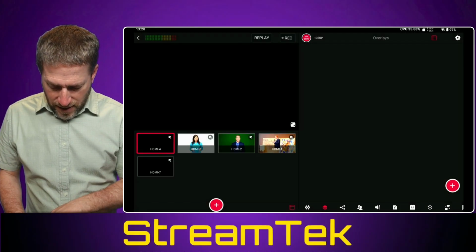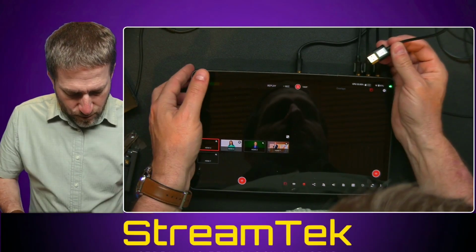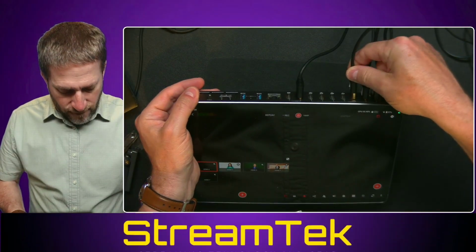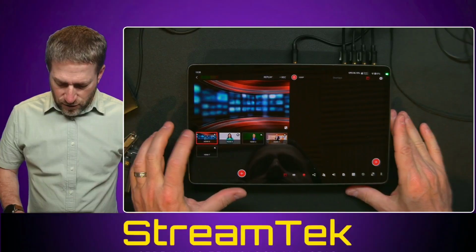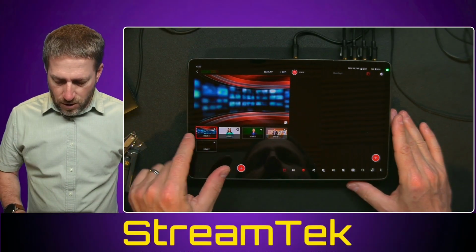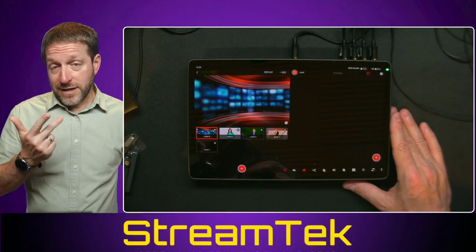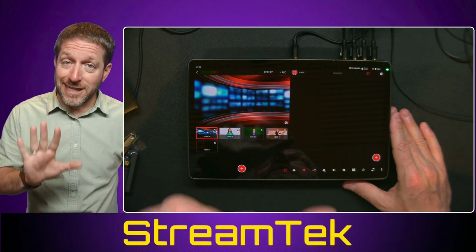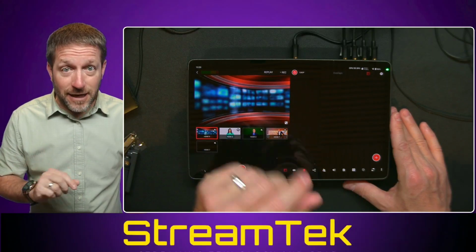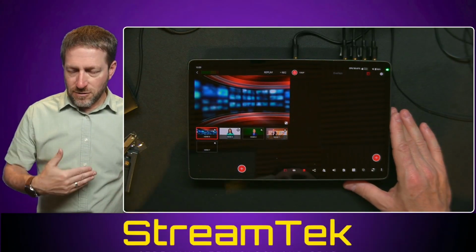Okay, good. I've got my HDMI 1, 2, 3. Those are my 3 HD inputs. You know what? I'm going to add a 4th HD input, but I'm going to add it to input 4, which is one of the 4K inputs. Now you can see it over here, and those are all ready to go. I didn't have to tell it what was input 4, 5, 6, 7, or 8, because those are all the 4K inputs, which are auto sensing. It knows it's HD. It understands that this input is HD automatically. It senses the signal coming in.